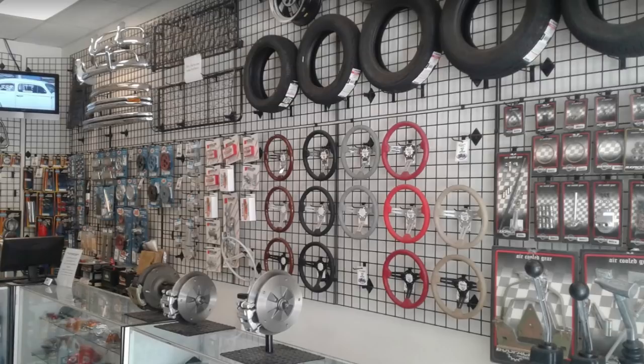If you're interested in this kit, we'll put a link below — SoCal Imports in California has this kit. It's a really well put-together kit. As far as how it all comes together, there are no tricks or snazzy things. We went above and beyond by painting the rotors and all that, making it look good. The hardest part is bending the lines and adjusting your little yoke — your pushrod. You've got to make sure you get that right, but it's not hard.